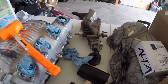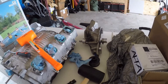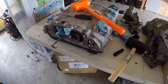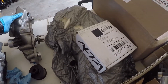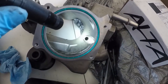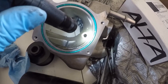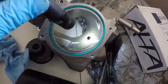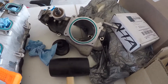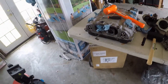All right, now that we've got that removed, we can continue on with the process of putting the snout in a press and getting that hub installed on there, then start putting it back together. The big takeaway though: make sure, if you're doing this, you check inside the throttle body port and get that bolt. It's a black bolt, so if you don't have good lighting, you're not going to see it very well. It's pretty obvious once you look — there's a big groove profile machined out for the bolt to sit into. I was pounding on this for a while, and it required more effort than I originally thought for just an RTV gasket.